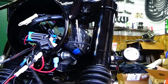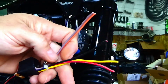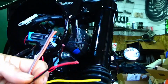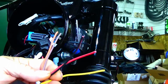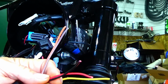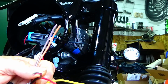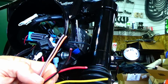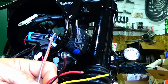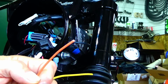Show you here. So I don't know if that's auto adjusting, I hope. Right, so there it is, just a little relay. And this part's kind of simple because you have your coils, which happen to be red and black, right? So when doing that, your coils are 85 and 86, right? And then what that does is opens up when there's power, and 87 is your normally open of the relay.